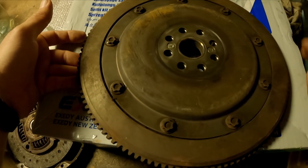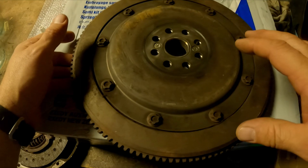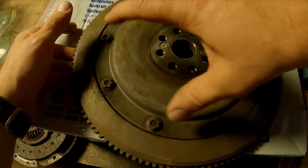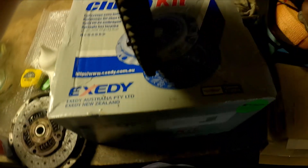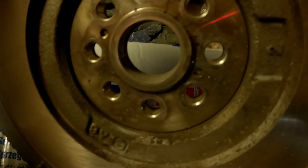You've got this other plate bolted to the back of the flywheel. This is thinner than the main flywheel material. A dual mass flywheel will absorb shock by twisting, whereas this one absorbs it going backwards and forwards like that — you can just see that.